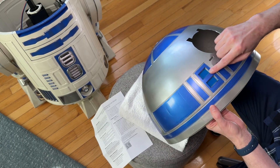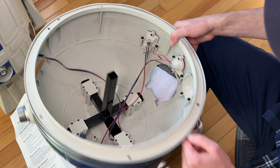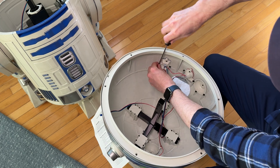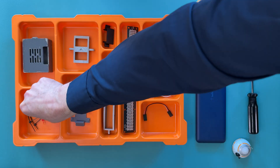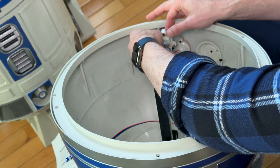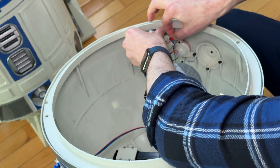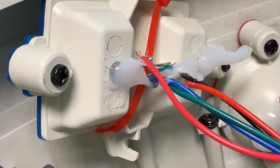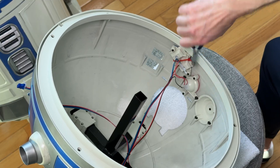Now we're going to go ahead and do the FLD. This one's a little more complicated. We're also going to be storing it inside using a zip tie so that we don't have to cut any of the wires. Be super careful with these wires — they are very fragile, at least they were in mine. Lots of hot glue going on in this thing. I actually did break one and had to solder it — I hate soldering, but it was easily fixed. We're going to secure the stock FLD inside using a red zip tie, threading it behind the screw post that is close to the FLD. Make sure you are not crushing any of the wires — slip it under so the pressure is on the plastic, not the wires. Go ahead and cut off the excess if you choose; you can also use scissors if you don't have diagonal pliers.